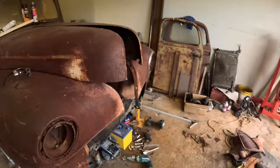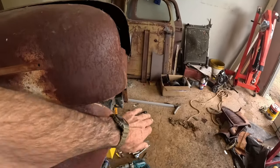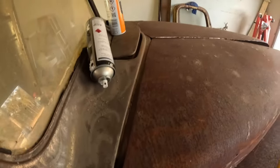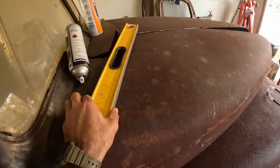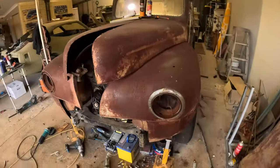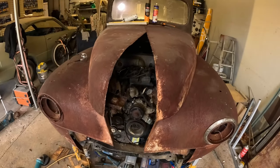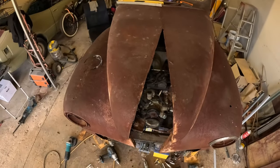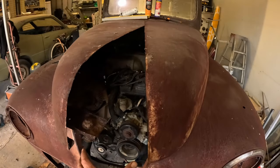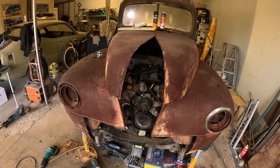I've shortened the front bonnet about 100mm. By the time this gets pushed in a bit flatter, I've still got about another 50-60mm worth of length to get that spot on. From getting parts from a scrap car it's coming along quite nicely. You can see how much I've spread the bonnet — it's going to make it less of a bird's beak front end. It's going to be a mission to shape and re-weld all that in, but I'll just do my best and take it nice and slow.